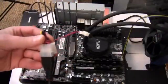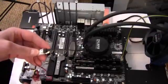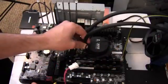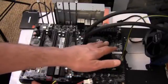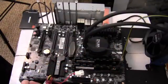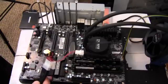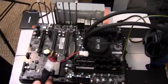I've got a Molex to 3-pin adapter running the pump, like I talked about. You can't really feel it much, but I put my ear to it and I can hear the pump is operational — just a little fail-safe for me to make sure the thing is going to kick on before I hook up the power supply and get the rest of the system connected.